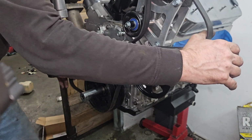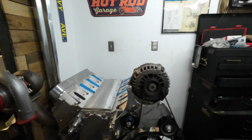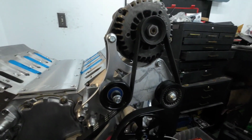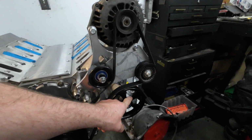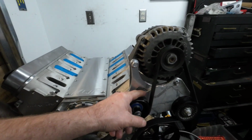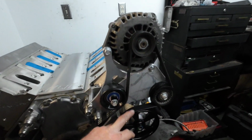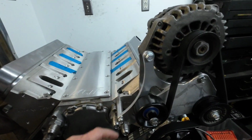Put that right there. Or I don't know if I caught everything because the battery went dead, but we got the belt drive set up and we're all off to one side. Again, this is a 90s LT1 pump with a pulley from Hawk's third gen, and then made this bracket, rough made it for an idler pulley over here. And that was just to kind of get some more wrap on the power steering pump, which I think we're good. It is pretty stinking tight.